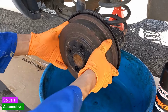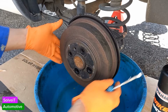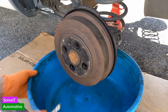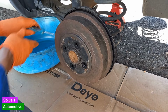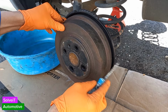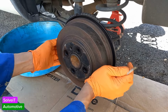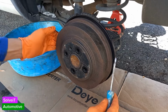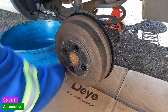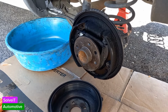In this case, my drum is coming loose. I'm just loosening him at equal points, bottom and top. Yeah, he's moving. I can see that he's moving. Just take that out of the way for now. He's moving out. Because you don't want to damage this plate here. You just want to keep loosening him slowly but surely. It's coming loose because over time I've made sure that I'm using the copper anti-seize grease underneath, which is very important. There we go. There we go. All right.